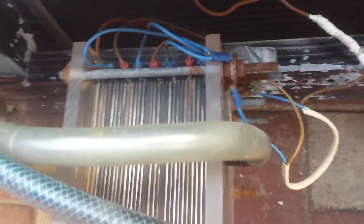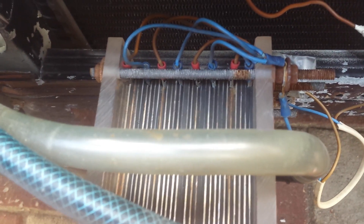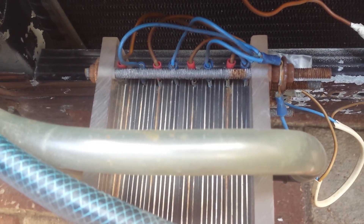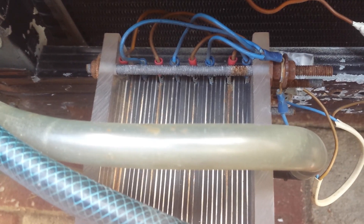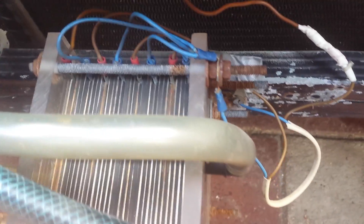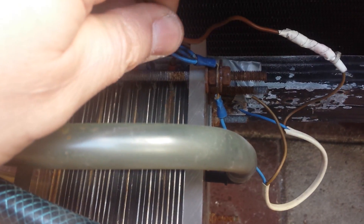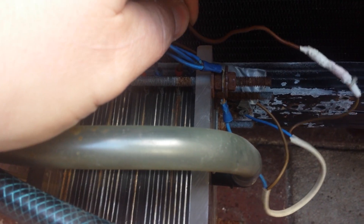I don't have any switches, and I think that's safer than having a switch because switches can sometimes burn or melt. These hydrogen fuel cells can put off a lot of heat in the wires, and if you're putting out too many amps it is very dangerous — you can melt the car's wires. Use quality, thick wires; don't use cheap thin wires.